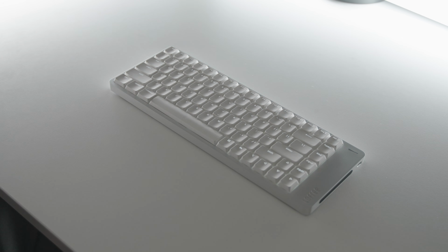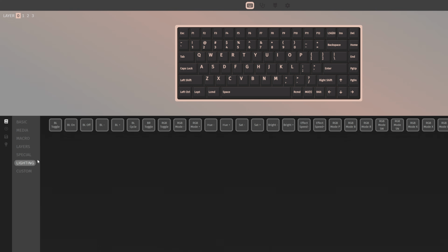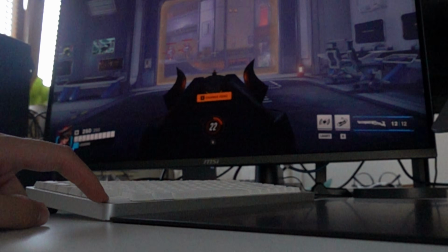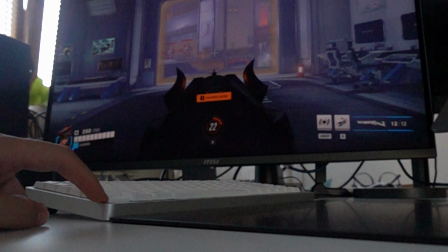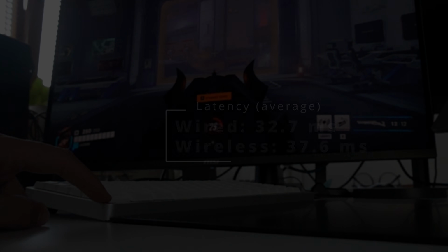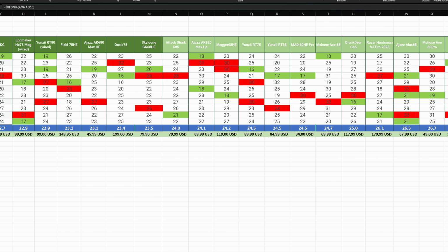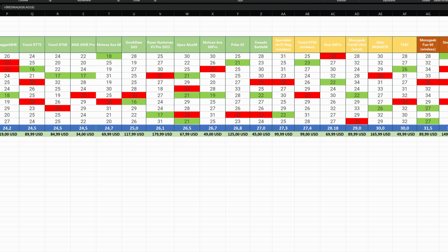Flow 2 is fully programmable via the VIA web app. Remap any key, record macros, or tweak lighting effects in minutes, all from a browser. Now let's move on to the bonus latency test. With a high-speed camera, I measured average end-to-end latency of roughly 32 milliseconds in wired mode and about 38 milliseconds over the 2.4 GHz dongle. Those numbers are plenty fast for productivity and casual gaming, though elite competitive FPS players will want an even quicker board, and for that, I suggest using one of the analog rapid trigger keyboards I have on my channel.